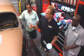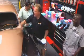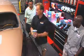Now most people do this one time. You did it recently, didn't you? And then you set the buffer down and you wipe splatter dots for hours. That's right. Okay. So don't turn it on until the pad is in contact. The other trick is don't lift it off till the pad stops rotating.